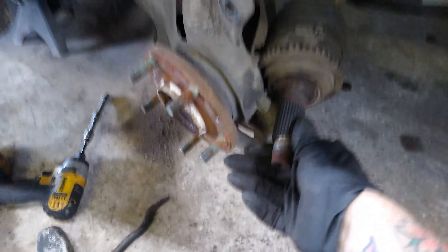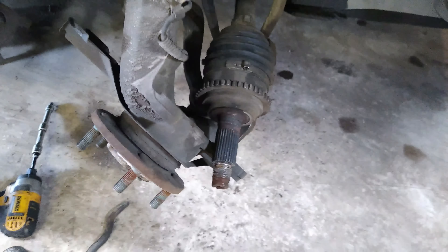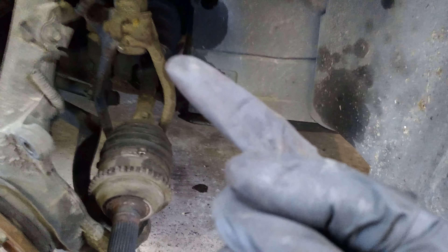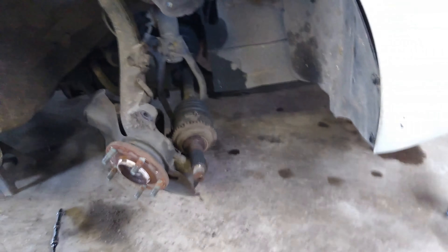So that's what it looks like when you get it out — I had to wrestle it just a little bit. Got to pull down on this and make some room. I also went in there with the wheel speed sensor — it's 8 millimeter and bolts on up in there. I took that off just to give me some more slack, which allowed this to come down more so we could pop it out. Now we're just going to slide under there and wedge a little pry bar in there and pop this whole shaft out.